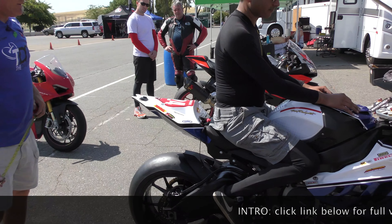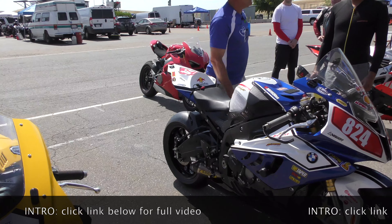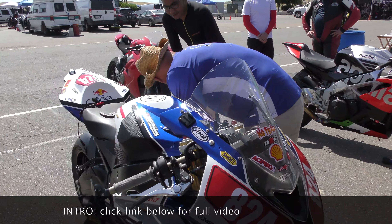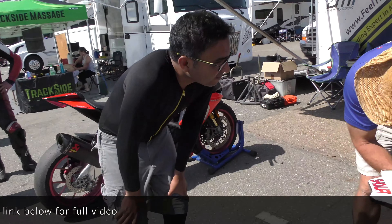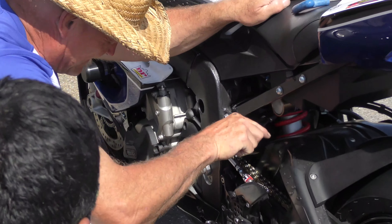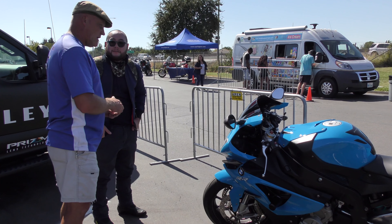90 in front, go ahead and dismount. And 15 in the back. You're going to double your body weight any time soon? I don't think so. So the bike was set up for somebody either a little bit bigger in weight or a lot faster, because the faster you go, the stiffer the bike has to be. So you want to leave all that where it is? Yeah, I think it's good.